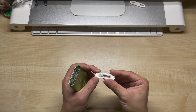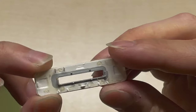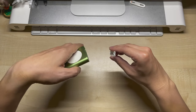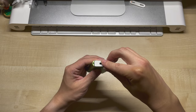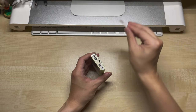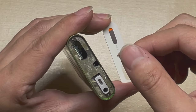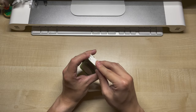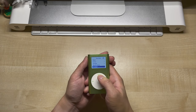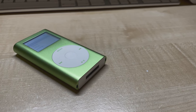As for the end cap, there's a specific way it goes. If you look at it you can see that there's a plastic bracket at the bottom edge whereas the open side is the top edge. You can also tell by looking at the clips — the top edge should only have one set of clips while the bottom edge has two. Just press until it clicks in. Now for the top, before you attach it just make sure that the hold switch is in line with the switch here — make sure they're both in the hold position because if they're not in line and you press it down there's a risk of snapping it off the board. We now have a working iPod Mini with a Taptic Engine.